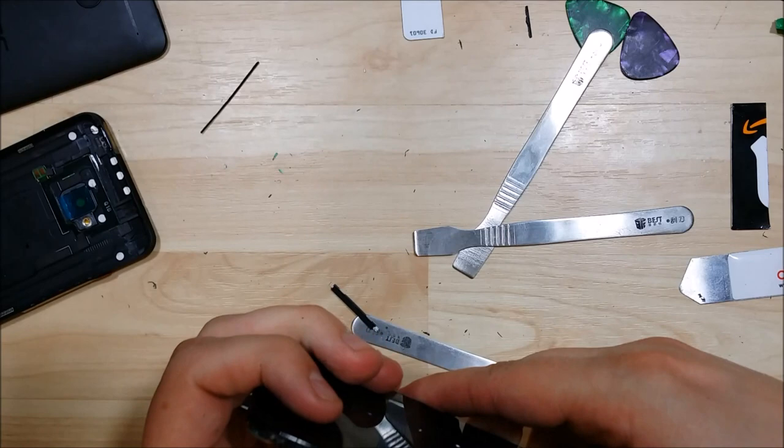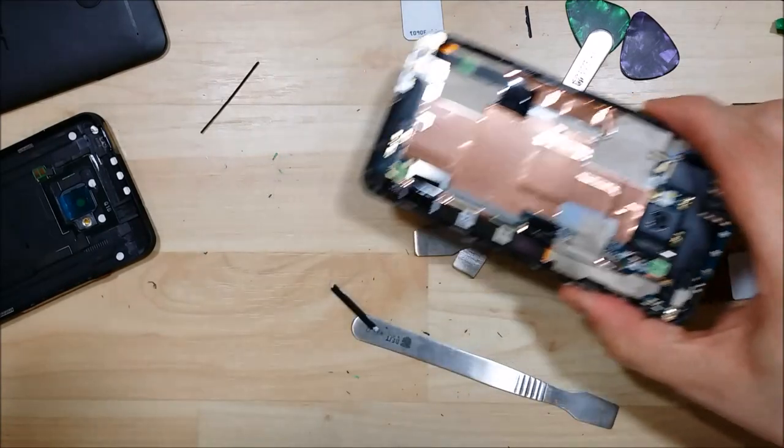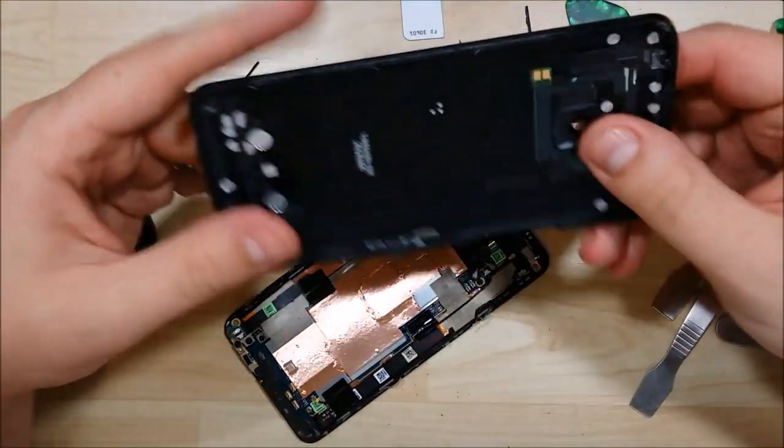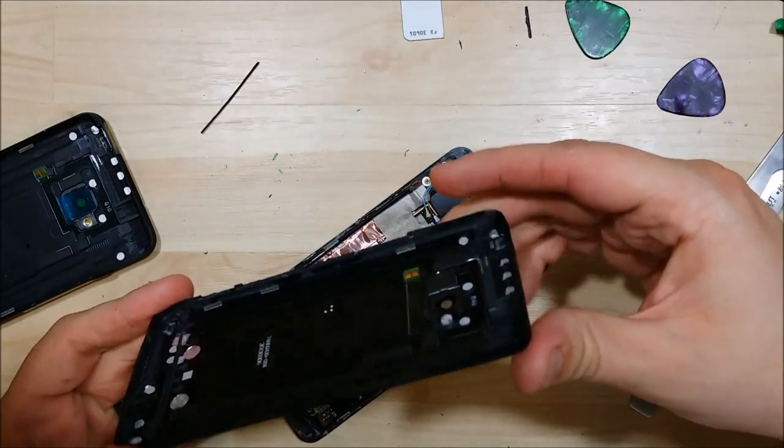Just checking around. The reason why it's very difficult with this phone is that when you're prying it away from the sides, the actual clips where the clips clip onto the back of the frame are also plastic. So you want to make sure you only pry on the metal areas of the back part of the phone and very gently.